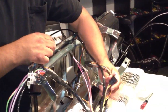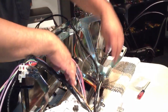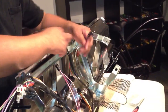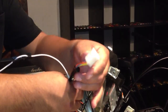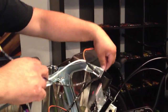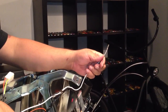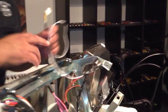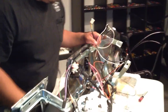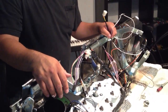You've got your heater and air conditioning connectors, flashers, clock, the light for the AC assembly, more AC connectors. You've got your glove box light and then your passenger side door jamb switch for your dome light and any courtesy lights if you decide to mount those. All those other connectors don't mount until we either have the AC installed or until the dash is actually mounted into the car. That's where we're at right now.